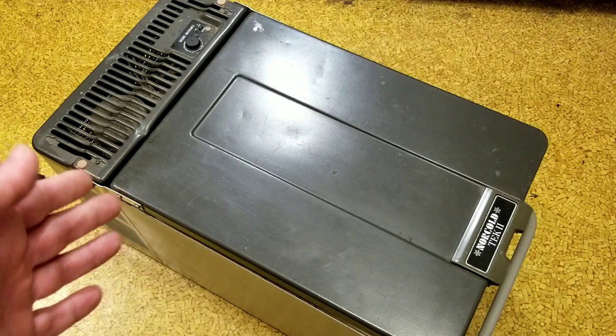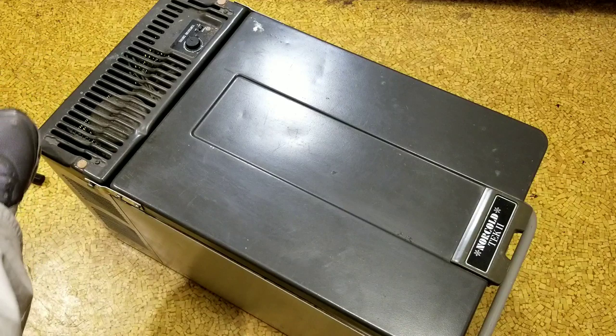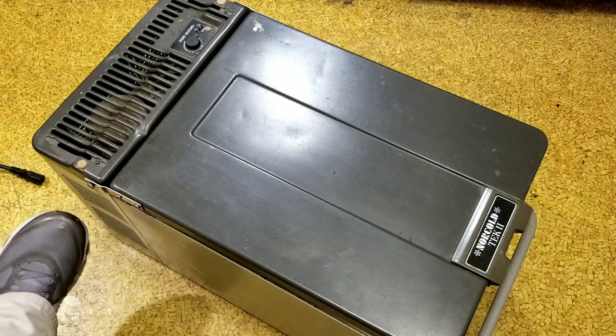Now these can be found in older Winnebago and some other motorhomes and RVs — that's actually how I ended up finding this one. There is a junkyard in my area which does get RVs in. Some people have had issues with these in RVs, but usually it's because this whole thing is tucked into some kind of hole and there just isn't enough ventilation for the hot side to really clear out. These work best when the hot side is just completely exposed or open. If it's going to be pushed into any kind of compartment, you need some type of fan to get air moving through the coil, otherwise it just can't transfer the heat from the inside to the outside, and it is passive.